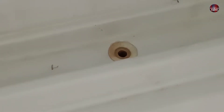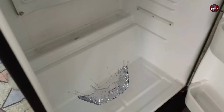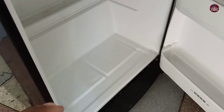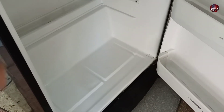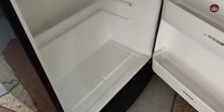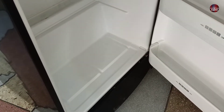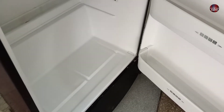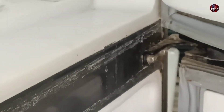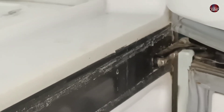Cleaning this hole in the refrigerator has many benefits. When this hole is clogged, the water comes out of the refrigerator and we don't understand where the water is coming from. This is the place where the water comes from. When the hole is always cleaned, no water will leak on the front side of the refrigerator. When the water leaks, it damages the door hinge and body. We have already made a video on how to fix a refrigerator door that broke due to this problem.